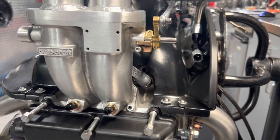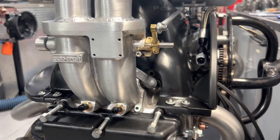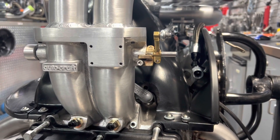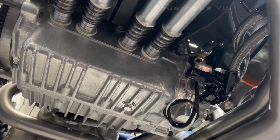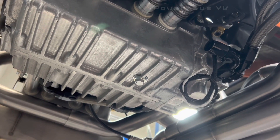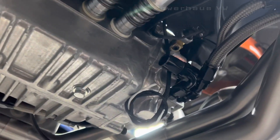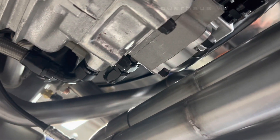Had to fabricate all the mechanism in the center there for the twist linkage. The manifolds that hold the throttle shafts and butterflies were really low profile, so couldn't find anything to fit. Mounting it to the Scat case basically meant having to make everything out of some scrap aluminum. Since this is a dry sump case there's no external or deep sump, so we have plenty of ground clearance. This one's going to use an external oil tank to hold the oil, and we used a CB Performance dry sump pump modified for full flow.